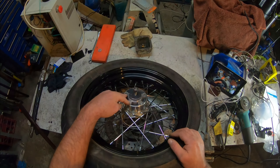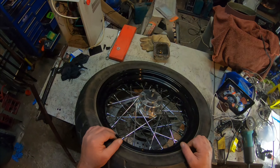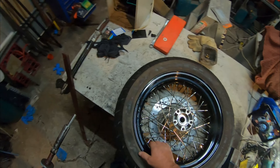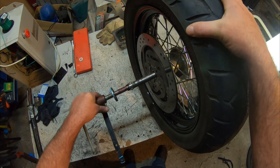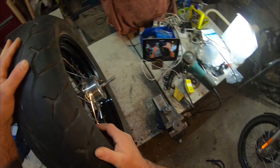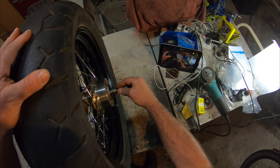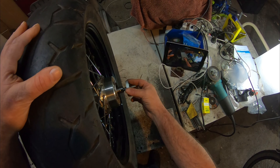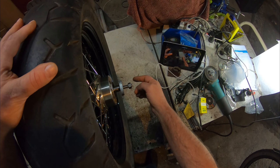I've just taken the drive pulley off so I can clean it up properly. Like the rest of the bike it's pretty filthy, covered in dust, so while I'm doing this maintenance I'm going to give it a bit of a clean up at the same time. To set the tool up it's pretty simple — we just insert the whole thing into the wheel. You can see on this side it's out a bit, so I'll just crank that down to match the right size. Once the bearing is in place, the plate goes on and the nut goes on.